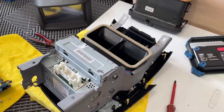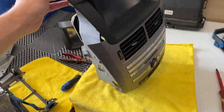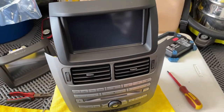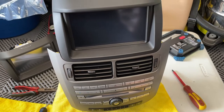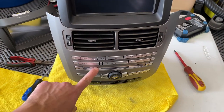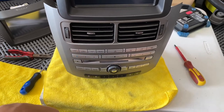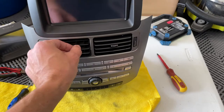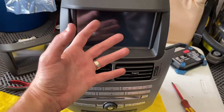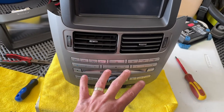She's all put back together now with the replacement screen in the original ICC. Hopefully we won't have that error anymore, because it's the original radio. It's got to do with the BEM and all of that CAN bus lovely stuff. But the screen, from what I understand, is its own unit — it's just a display with a ribbon cable going to it, whereas this is the thing that's actually locked to the car, or VIN coded.